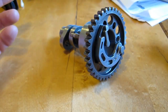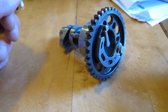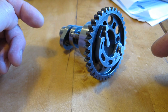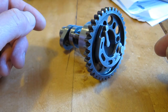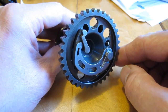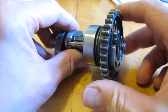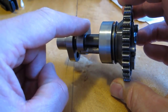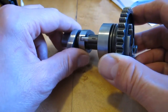I'm going to show you how an auto decompression cam works. The auto decompression cam assists to make starting easier by decompressing the cylinder, placing less load on the battery. Here, looking at the front of the cam sprocket, you can see the weight attached to a pin that provides decompression on the exhaust cam when the motor is not turning very fast.